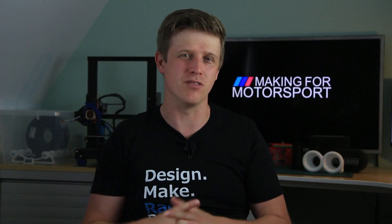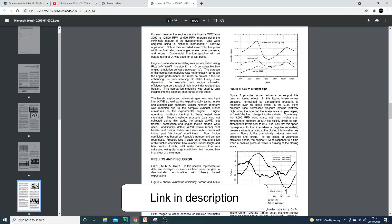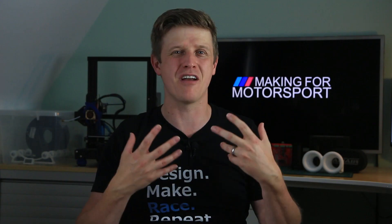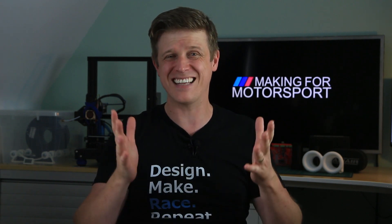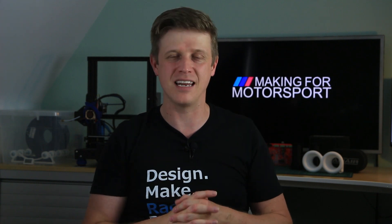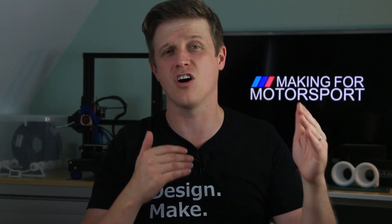When I really researched this — looking at academic papers and textbooks, not just forum posts and YouTube videos — I found it works in a somewhat different way than I just described. But that doesn't matter because the outcomes are the same: there is a pressure wave that moves up and down the inlet tract and gives you a boost at certain points of the rev range depending on that length. If you want these benefits at the top end of the rev range you have a shorter inlet tract; for the middle or low end you have a longer one. For my application I want this in the middle of the rev range, so I'm going to have as long velocity stacks as I can fit in the engine bay.